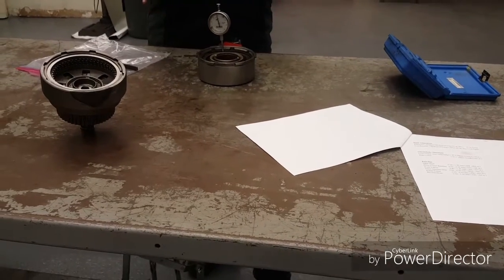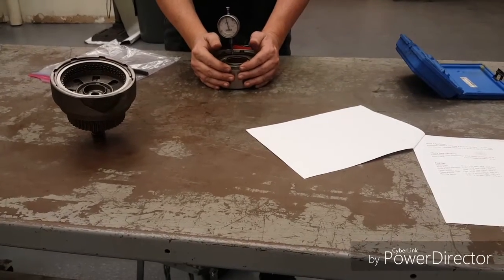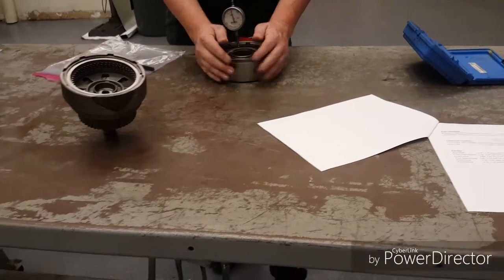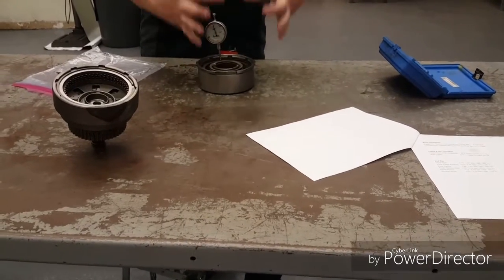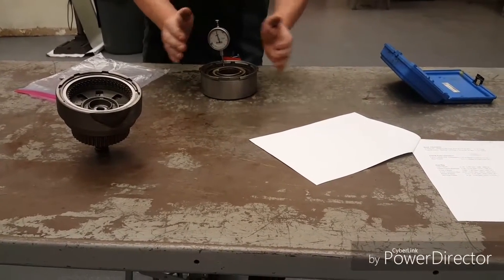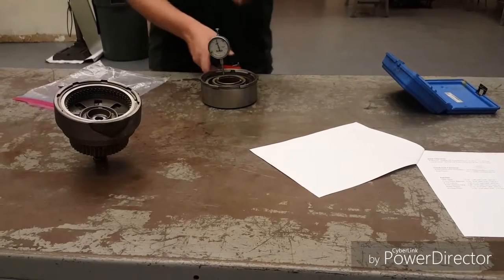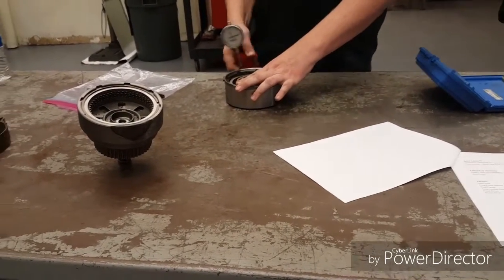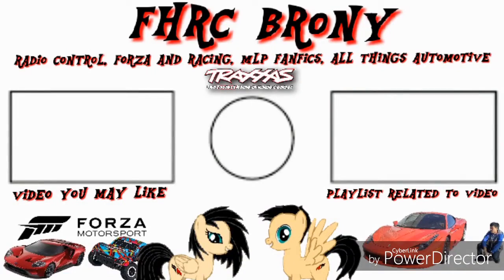So here's what I'm going to do — all my pistons are in there. Let's reassemble them carefully. I'm going to remind you probably three or four times as I walk around: don't hover your face close to this when you reassemble it. And if it's not pressing down, you need to reposition the drum. So let's go ahead and reassemble them, get your snap rings back in. I'll leave this here if you want to try using the dial indicator to measure it.